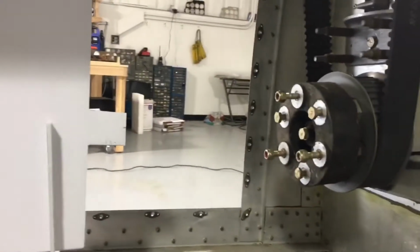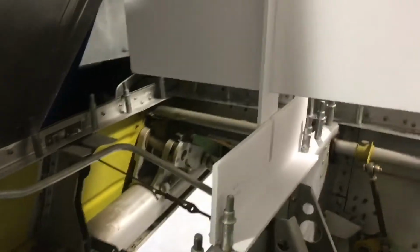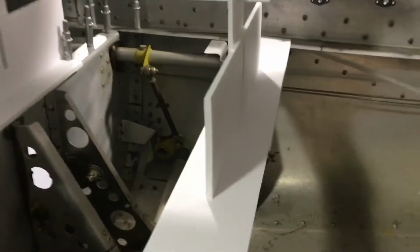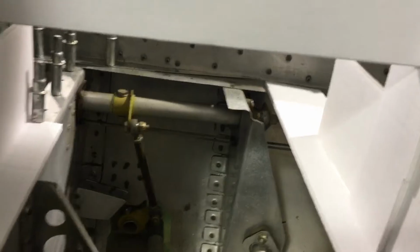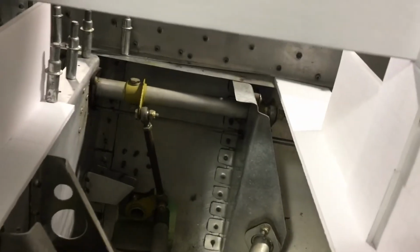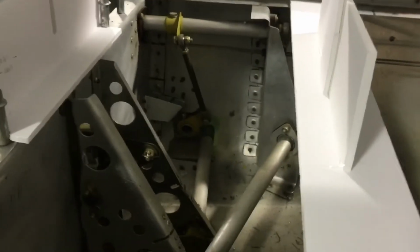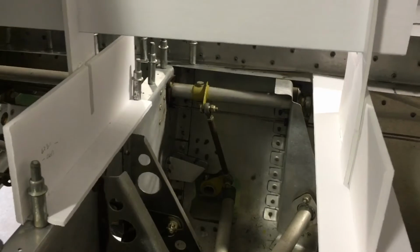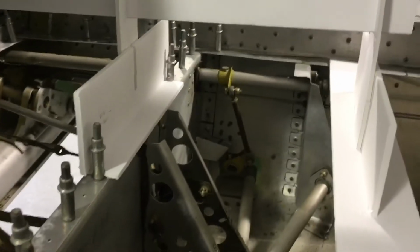And the engine looks like it's going to have to rest up just about that high. And that lines that output shaft up for the drive. And that gives me an idea of where this engine is going to sit in relation to the rest of this engine base. To be very clear, I need to come off of this one support that was already installed on one side for the aileron tube, and beef that up a bit and make a support that goes all the way across so that I have the type of support that this engine is going to require inside of this airframe.